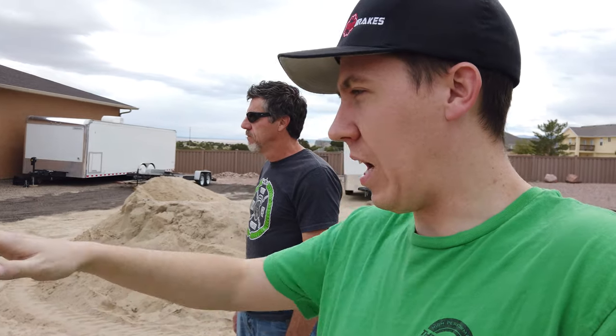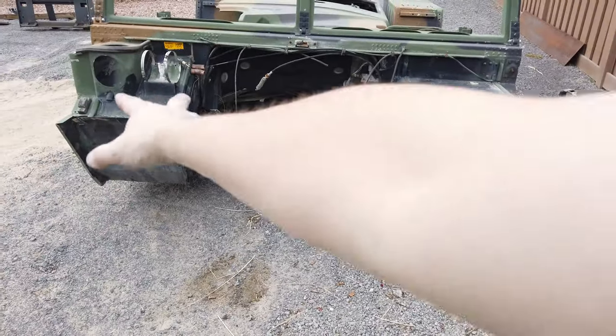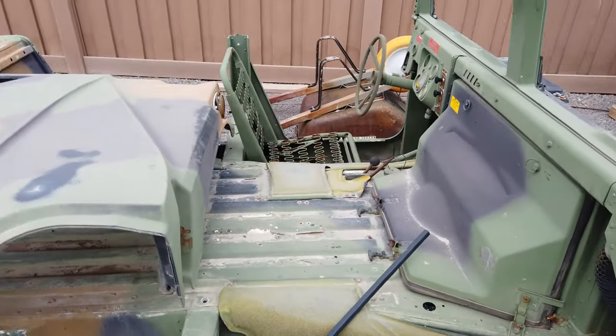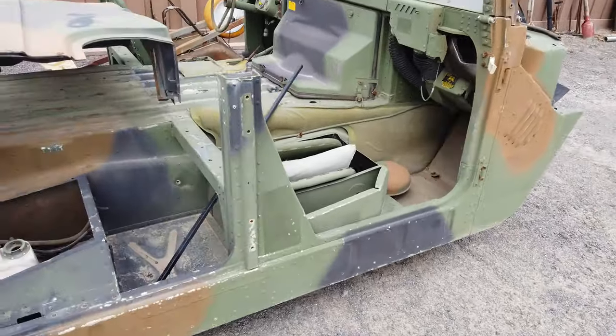It has a 5.3 — that's good. It's got a tranny we don't need; a Powerglide is going to work for doing the burnout stuff. He wants to slam it down low. We weren't sure if the four-wheel drive is going to work but we'll go over a lot more of that in future videos. For the H1 we'll probably have to narrow up the chassis because there's a big gap — the chassis has a big opening that's quite a bit wider. We've got to shrink the chassis, notch it down through the center. It's a complete body and they're aluminum — quite a bit different. Look how wide the tunnel is. It's going to need a complete chassis built underneath it pretty much, and the Suburban is a quicker way to get there.